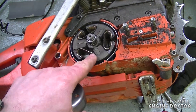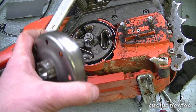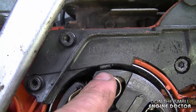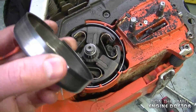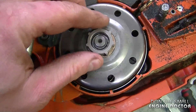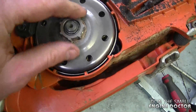The oil pump is located underneath the clutch, so I'm going to put the clutch drum back on and show you exactly where to line up these grooves. Inside here you can see the arm and the tip on both sides, so it's really easy — you just line up the clutch holes to the arm, or arms, because it's actually on both sides, and you just put it in and make sure it's all lined up together.